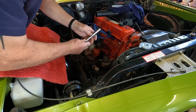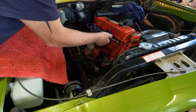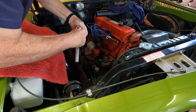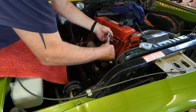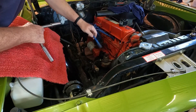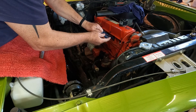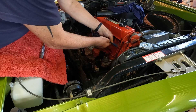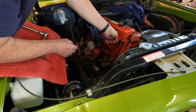I'll just put this back - do that by hand. Don't over-tighten the spark plugs, there's no need. Just make sure the spanner is in the right spot, not leaning on the plug, and give it a bit of a nip - that's all you need. I also slide back the boot so I can see the metal part of the spark plug lead that clips onto the plug, to make sure I've got a nice firm connection. Screw it on properly, push it on, and then slide it down a little bit.